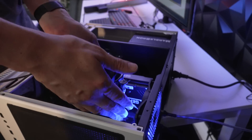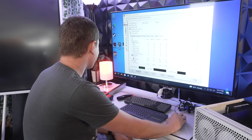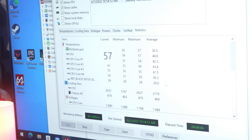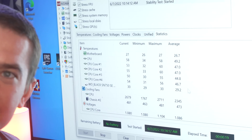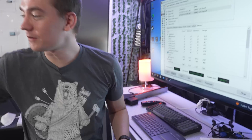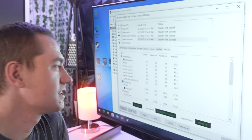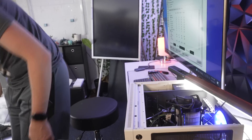That's working. I don't hear the fan spinning up. We're at 36 degrees. Starting the stress test — 52, 57, 50. It's not thermal throttling. What was it with just one? It was 60. We averaged 52.4 degrees. I think this 10-cooler tower is better than one, and we don't even have the extra fans. Let me add some extra fans for more cooling. 57 degrees. Kyler, I think you know what time it is — I should pull up my laptop and learn how to do the Fortnite dance.